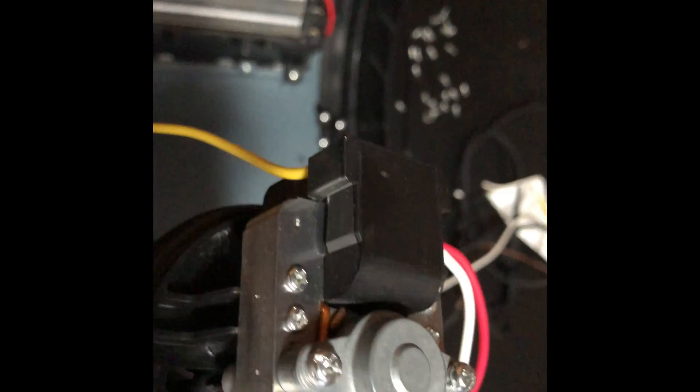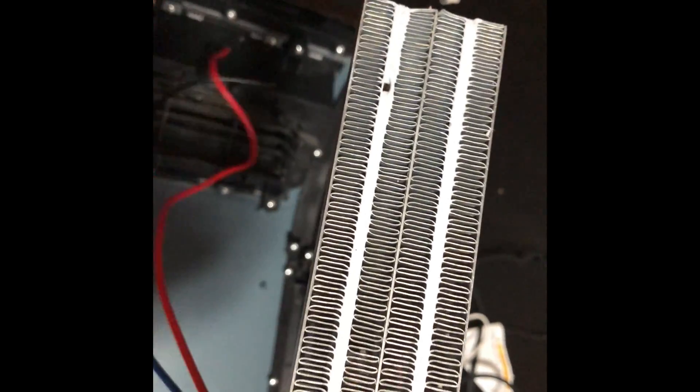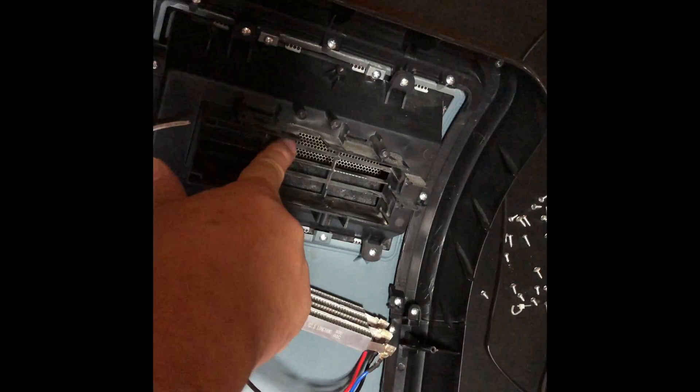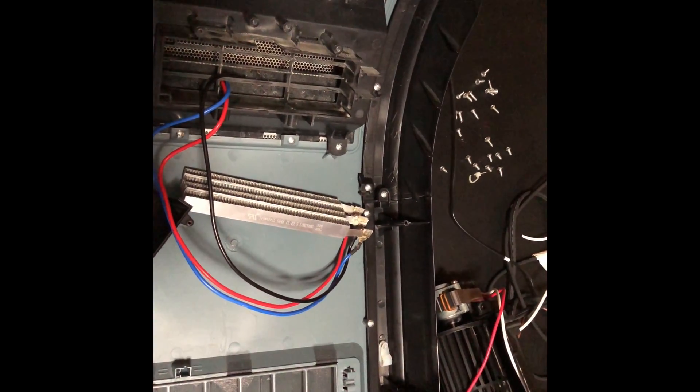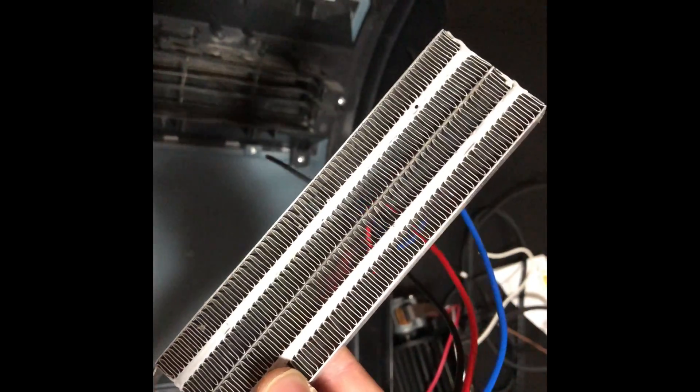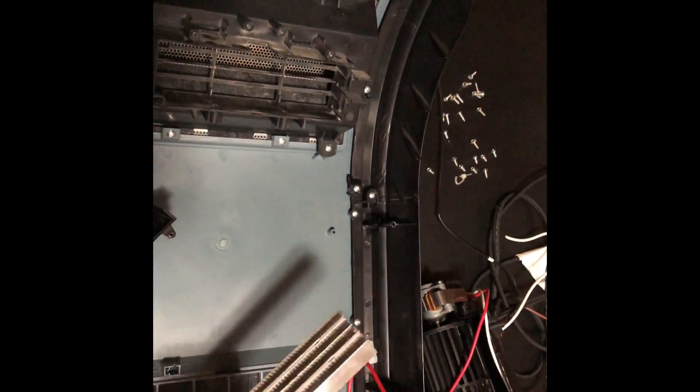Your blower assembly is just a plastic one pressed onto the shaft — no screws, nothing holding it in. And then there's your motor assembly. Here's your heating element — it's like a heat sink, with the insulating material which is this gray stuff right here, and this here is the grounding. I did keep this clean. What happens to a lot of these is people don't blow air through these vents to keep them clean every once in a while. After the season they put it away and wonder why it's not putting out as much heat. These vents get clogged with dust, and these elements are self-regulating — they go high resistance when they overheat — so you have to keep them clean to work as they're supposed to.